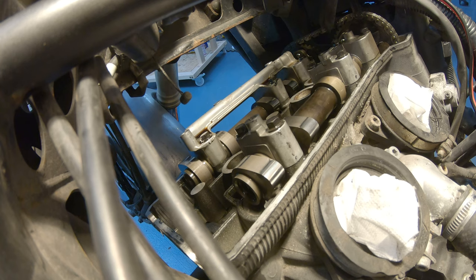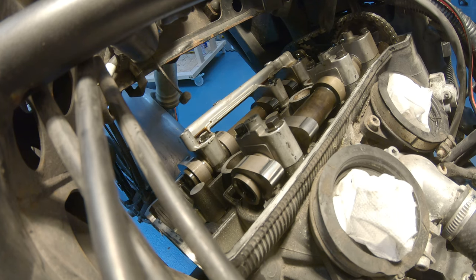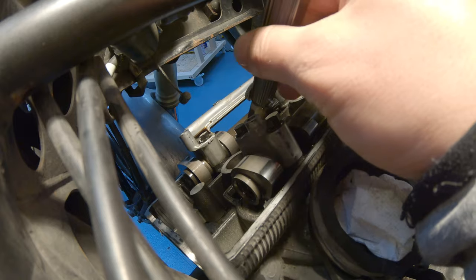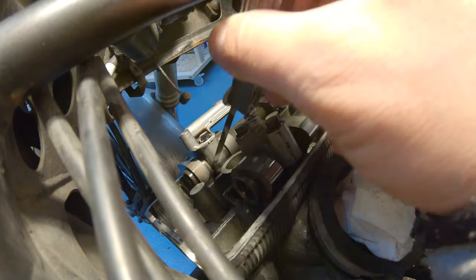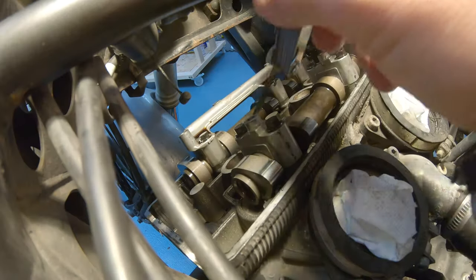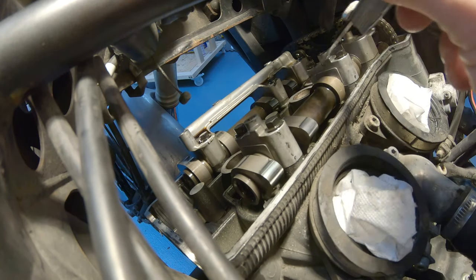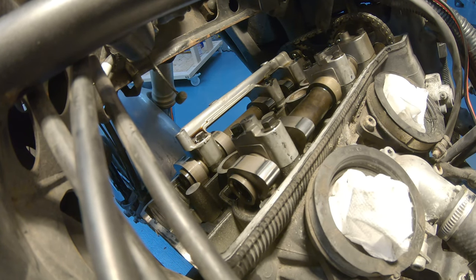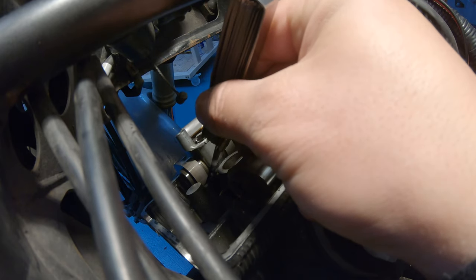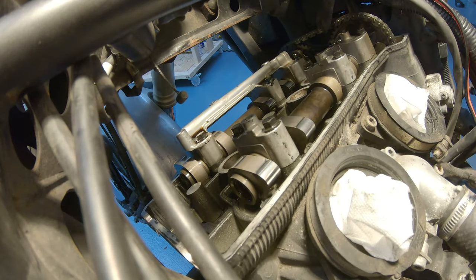The next blade that we have is a 0.20. So 0.20 is one blade. Doesn't go through. It goes through this one. So the left one is definitely more than 0.20. Let's try 0.21 on the left one. It seems like it's going through tight.